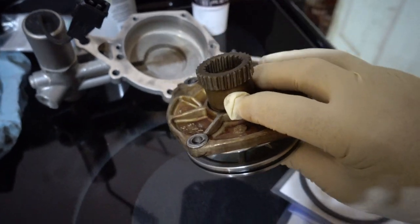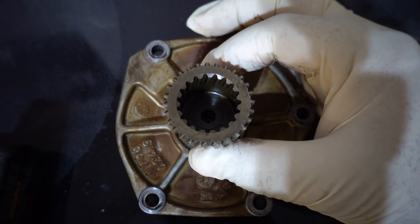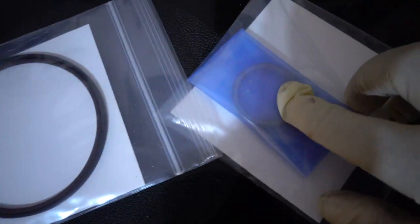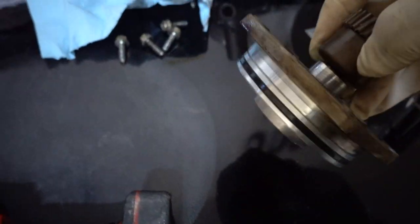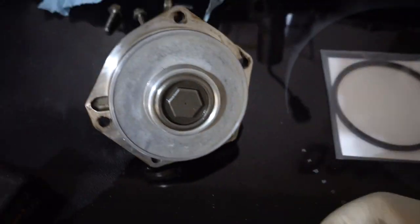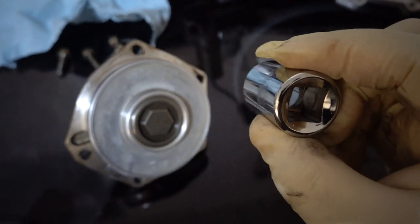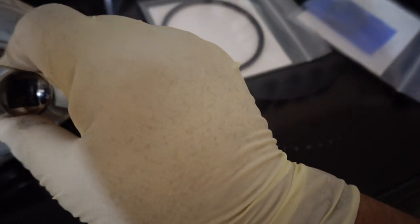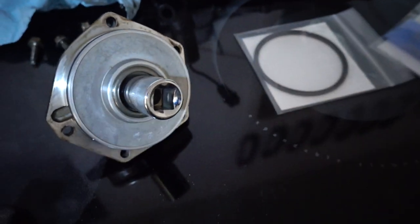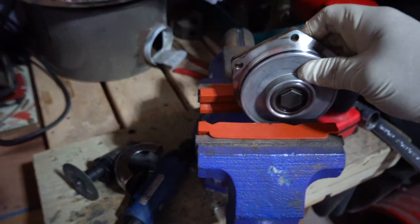We got the piston out of the single vanos system. The rattle comes right here — look, it's super loose in there. That's why we got the seal kit and the anti-rattle ring. First things first, you're going to have to take this nut off. This is a very, very shallow 18mm — most sockets come bubbled at the end, so you need a special socket or you can grind down a normal socket. Make sure you have some soft jaws on your vise so you don't damage anything, throw it in there, tighten it up and start cranking at it.